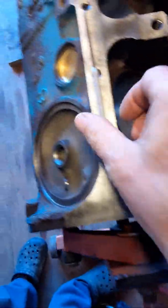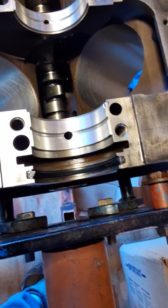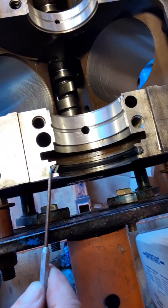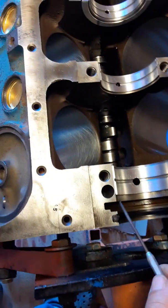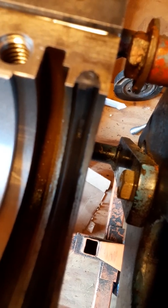The direction of the rear main seal — and I can verify it because I've even got it on my package from Felpro — you see this high part right here? They want that toward the front of the engine. That is where it seals against the crank. It kind of looks like maybe if you turned it around the other way it would just let the oil fall off and go back in the engine, but they don't want that.